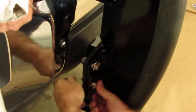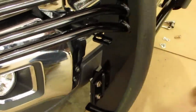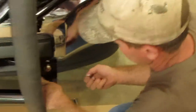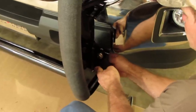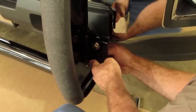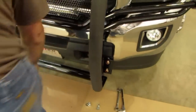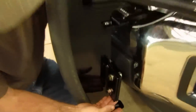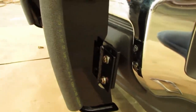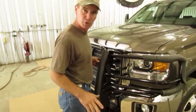Once you do that, you all can relax — we have bolts to hold everything on. Go to the other side and get all the bolts in first. Make sure you get your lock washers on there. Everything is provided with half by one and three-quarter inch bolts. Now we've got those four on. You can start out with this bottom shoe right at flush with your bottom bracket — that will get pretty close height to height. We are going to put a jack up underneath it to get it there, then you can take the foam off.